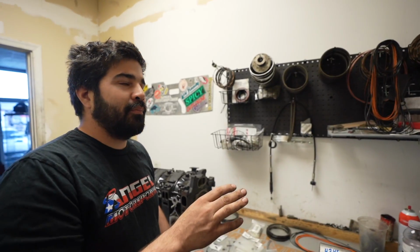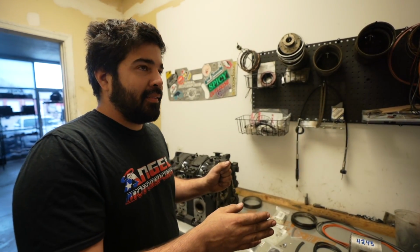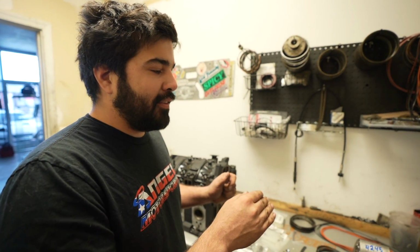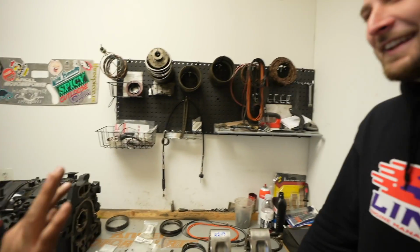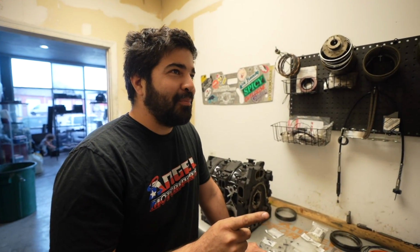Yeah, you're just moving the power around. So let's say 14 pounds is the max on a turbo rotor, before you start hitting detonation around 17, right? Yeah. At 14 pounds, I like to say max because you can beat on it and beat on it and beat on it. When it's 17, you beat on it once, then you gotta let it cool down. You gotta let it cool down, yes, because the second or third pull is probably gonna blow up. You would know better than anyone.